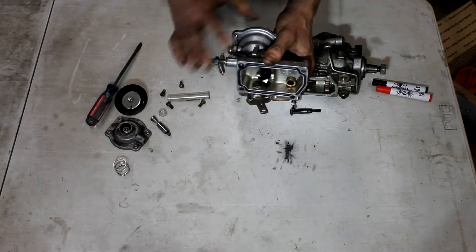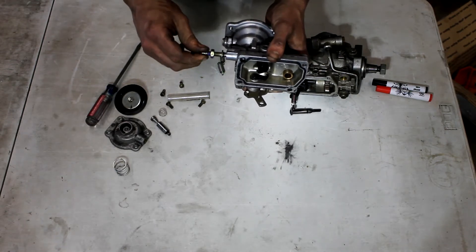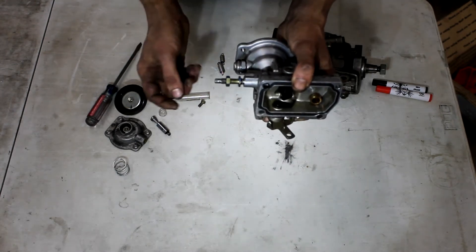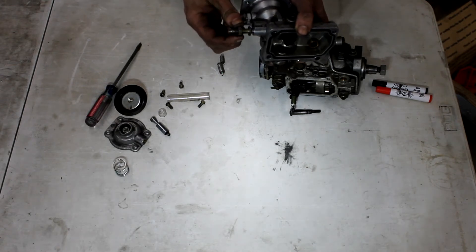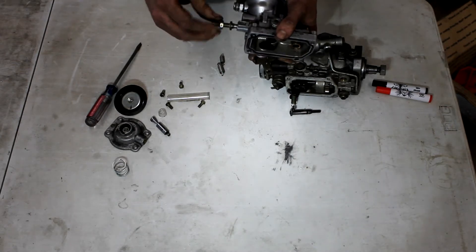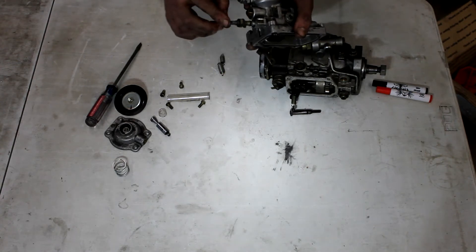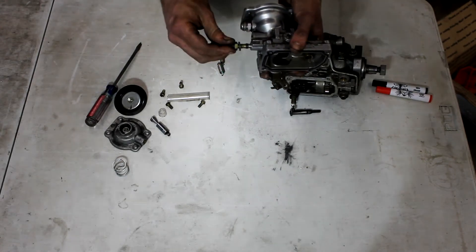This is the fuel metering screw. If you ever take this top off, the only way to put it back on is to back the metering screw all the way out. The metering screw is an M8 by 1.25 thread - I'd have to double check that. There's a welded collar on there - if you take a drift and a vise and hit it where the clamshell parts are, you can break that collar off and rethread it using the nut. There is an O-ring on there that will leak if it's out of position or bad. There's a staggered washer setup for sealing - this all needs to stay in place, with a flat cap on the back. These usually get rounded off; grab them with small vise grips to turn them.